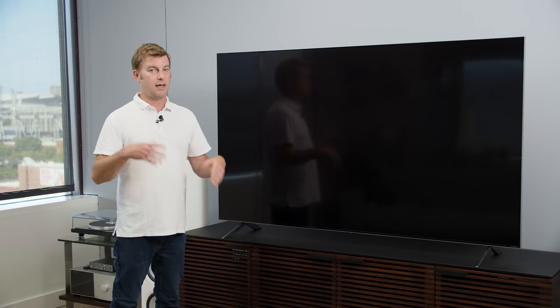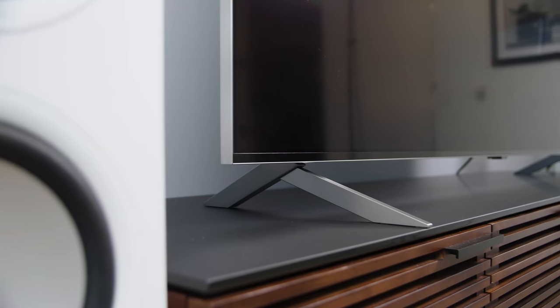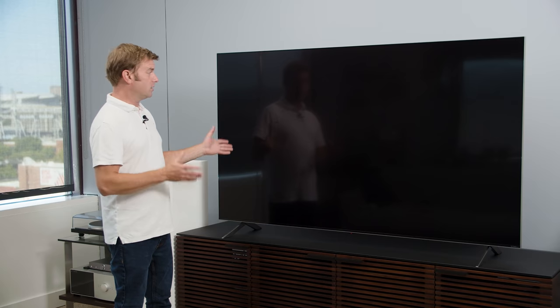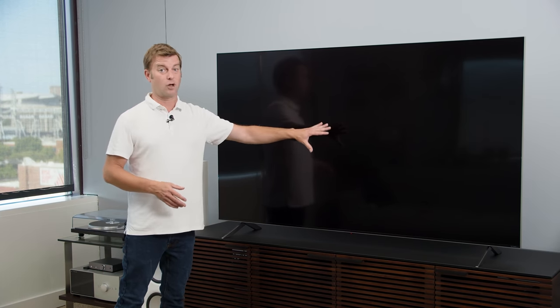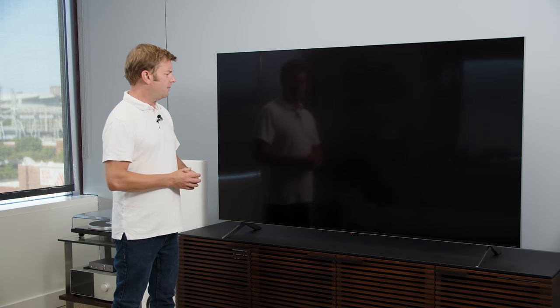Here's the front of the TV. Not a ton to see — the metallic bezels are really more of a border; once you step away, you don't see them. There is a little bit of a black matrix around the edge of the screen, which is typical. It's remarkably stable considering how heavy the TV is. The thing I'm noticing the most is the generous amount of anti-reflective coating, which is doing plenty to dim the lights. This is an IPS panel, which already struggles a little bit with black levels, so I'm interested to see how that plays out once we get this thing turned on.